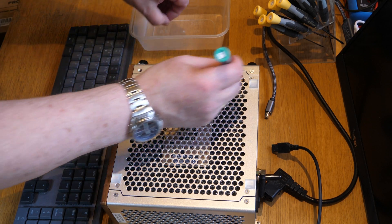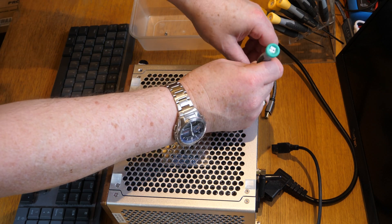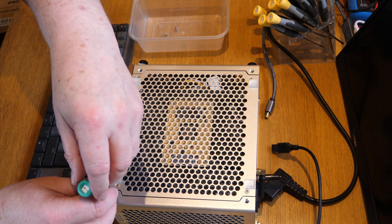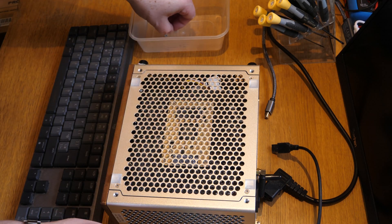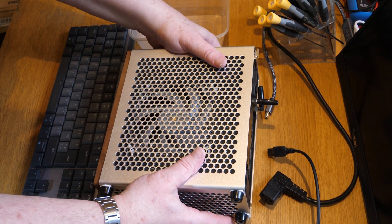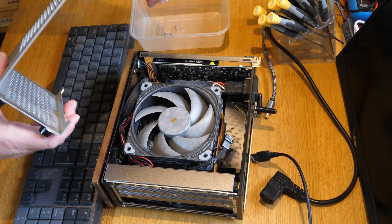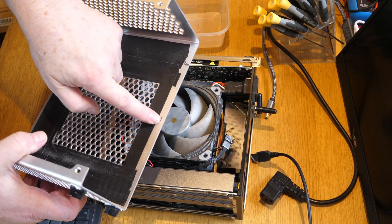The case is a Densium APU 4 litre case, and in order to get something like a 7950X — or indeed a 9950X — to work in such a small case, you need to run it in Eco mode. I use 105W Eco mode, and it just about squeezes in so that you can run all 16 cores in Aida64 just under 95 Celsius.